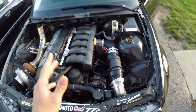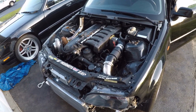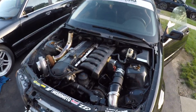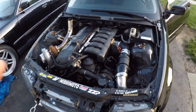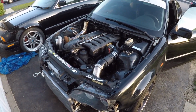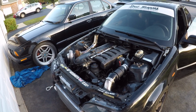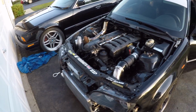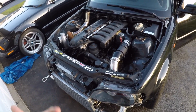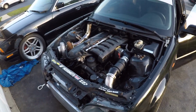So yeah, there's two problems here. The first problem is what? First off, Alex is dying. Pretty much. So that's the first problem. Second problem is it won't rev, and there's a couple things about that that make it a big problem. First, my car's been doing this thing where if the MAF isn't plugged in or it's not reading a MAF, it won't rev. And the second problem about that is the car should run and rev with no MAF, and there hasn't been anything changed in the tune to change that. Stock MAF, anything, it should drive, and it's never been able to take throttle input with the MAF disconnected.